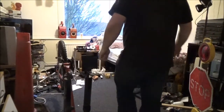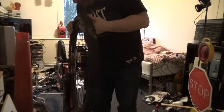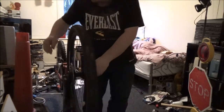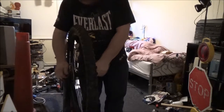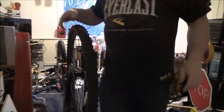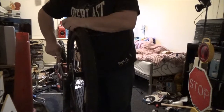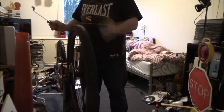Let's move to the front of the bike. This is why I like disc brakes — you haven't got to disconnect anything to get your wheel out. It is just a case of undoing your wheel bolts and pulling the wheel out and dropping it back in. Got some adjustments to do on the brake caliper because that is rubbing, which I might take care of while that is upside down. Rubbing is not good for two reasons: it prematurely wears down your pads and it can cause friction and make it harder to pedal.